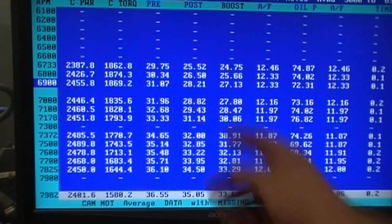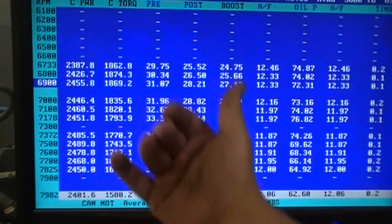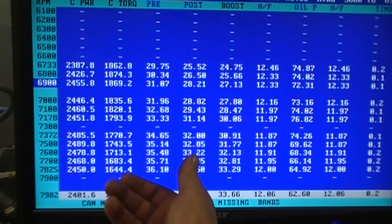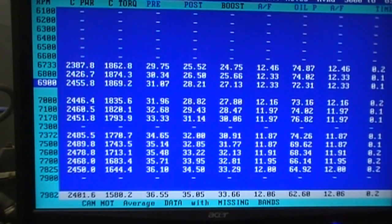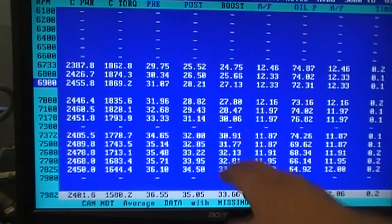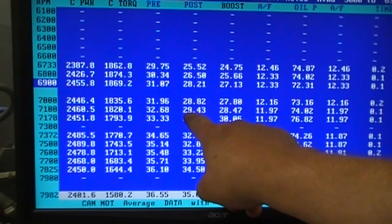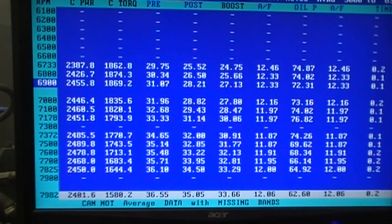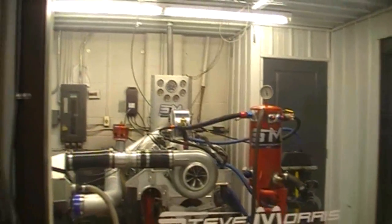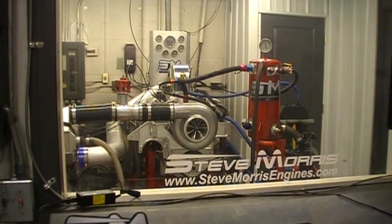With the F3-136 and 5-inch tubing, still spinning at exactly the same rate. At 7,700 we're up to 2468, 2477, 2489, 2485. Really nice piece. We can also see here the post-intercooler pressure ratings — very minimal drop. Around 7,000 it's about a 1 pound drop. We've totally gained 2 pounds of boost back on the 5-inch piping. So we're going to put the ProVolute Bell on it for anyone that's interested, and we'll come back and make our last pull.